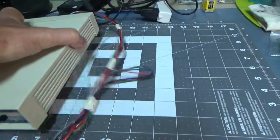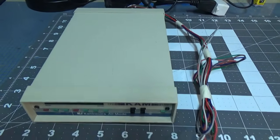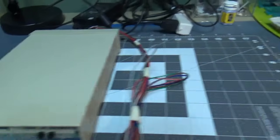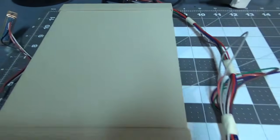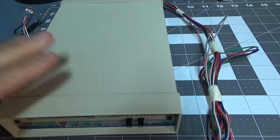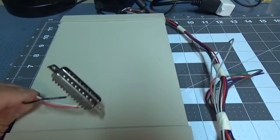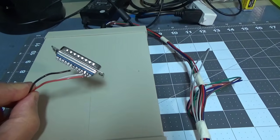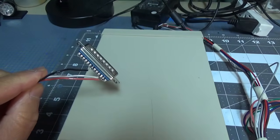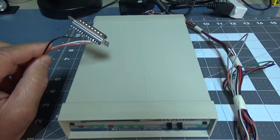Now, as far as connecting to the TI-99/4A, it turned out to be a little bit more tricky because the TI's RS-232 connector is not quite standard, and a straight through serial cable between the KAM and the TI just did not work. I ended up creating my own cable, which is really a 3-wire, which crosses the RX-TX lines and supplies a ground, and that was just enough to create an excellent connection for RTTY purposes. So why don't we go ahead and demonstrate that?